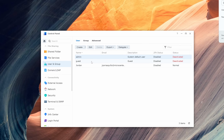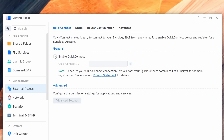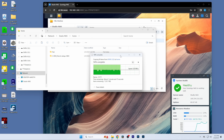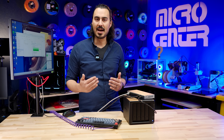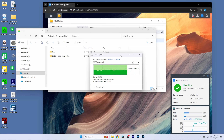What I really like about this system is that I can create credentials for everyone on my team and we can access these files from anywhere. I can create a username and an access password — they can log in on the portal on any browser, and you can keep it restricted so if you only want to share certain folders, you can do that. You can use this as sort of a Google Drive, except it's a Google Drive that you own, so you're not paying a monthly subscription. It's been going anywhere from about 450 to 530 megabytes per second. This is only an 80 gigabyte test — if I was going to do a really big backup and fill up that two-terabyte cache, it would slow down. But the majority of stuff we're moving is going to be smaller than two terabytes, so we're never really moving more than two terabytes at a time.